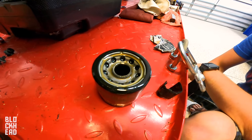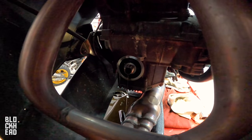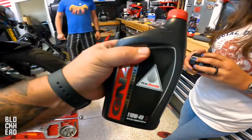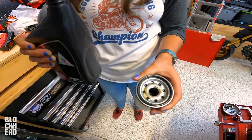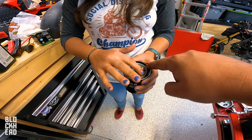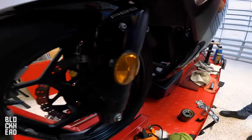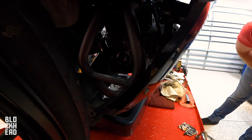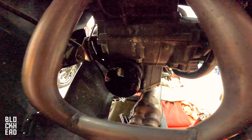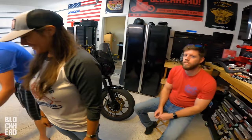That oil looks really clean — it's like it only has a thousand miles on it. Really clean oil. We're gonna need to prime the filter. Take some of that oil and put it on the ring — the gasket. Then wipe the old filter surface down, and you basically throw the new filter on one-hand tight. Yeah, oil filter, hand tight.